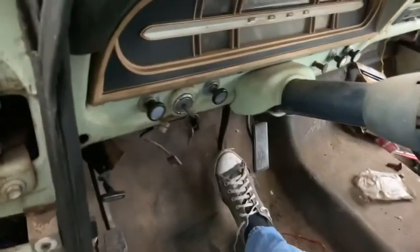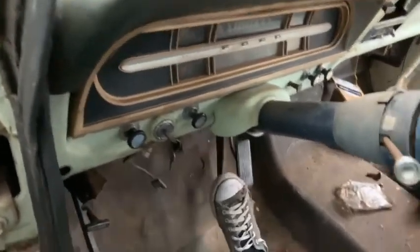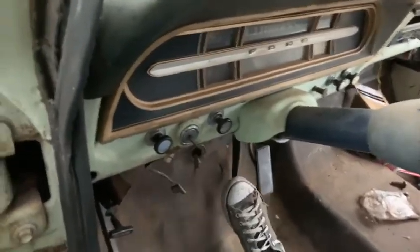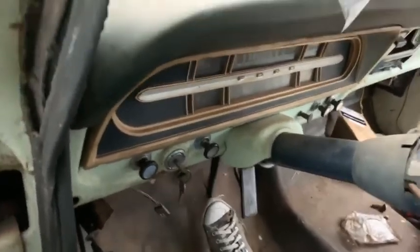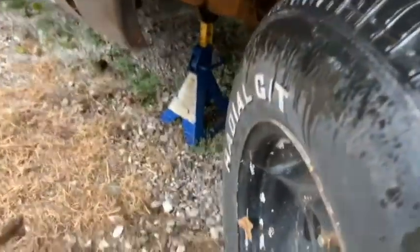The rear line is tightened up. All the bleeders are out of the back. I think I hear stuff going on back there. I'll go ahead and pump plenty of it out of there so I can be for sure. No use in crawling under there 3 times. I can hear something for sure. Something definitely liquidy coming out of the back. Yeah, we're soaking that up real good. I'm gonna go ahead and clamp this puppy off. We'll see what happens with that.